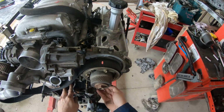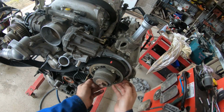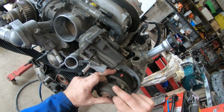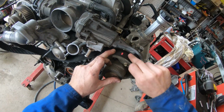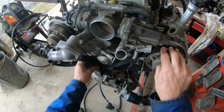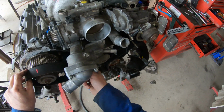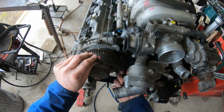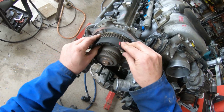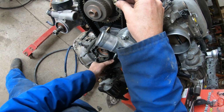And then we bring it round up onto the cam pulley. And of course, it hasn't moved, which is fortunate. And we just run that belt round. And here's the line, comes to the dot, back to the line, the big line on the back of the cover. We bring it round here to this pulley. Just going to pull it out a little bit like that.